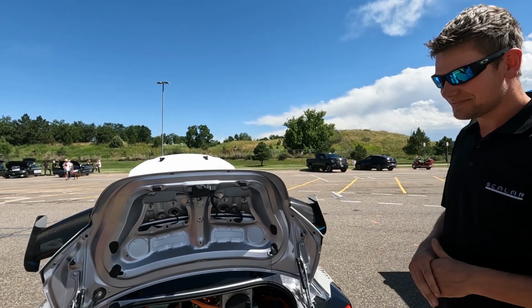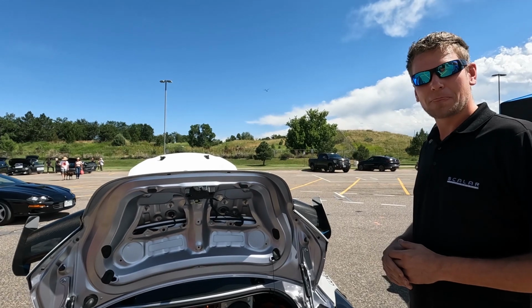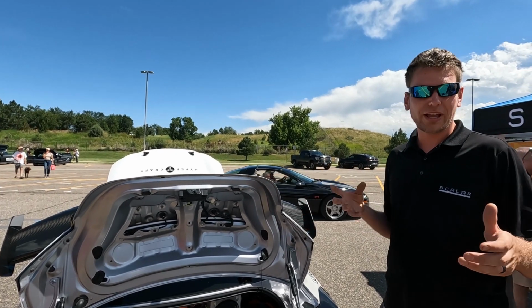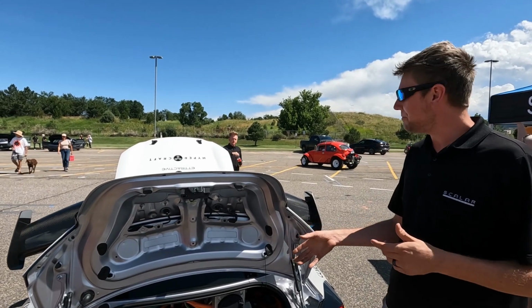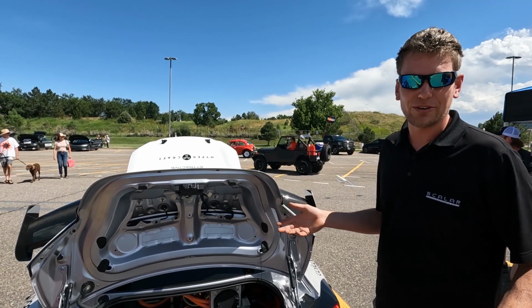That's really cool. I mean, dry sump you hear about in ICE cars. Yep. When you start going fast enough, you need it. Yep. But now we have it for EVs too. Yes, and for the motor, it's mostly for cooling. The lubricating needs for that motor aren't very high. It's just 2 bearings on the end of it. And as far as getting back to maintenance and serviceability, this motor needs the bearings changed about every 1,000 hours.